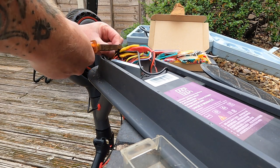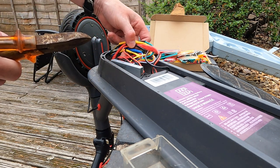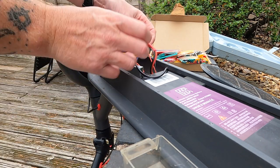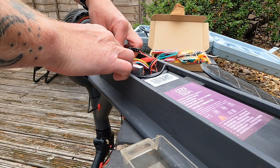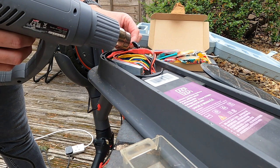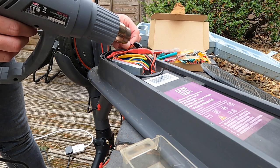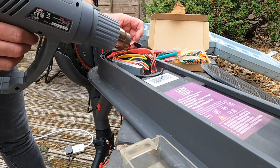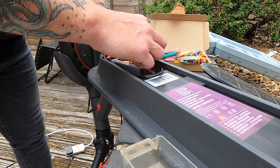Just removing a couple of the old cable ties that helped keep the loose cables neat and tidy. There are only two cables that go to the battery. You'll see that you can't really go wrong understanding which ones they are and connecting them back up. If you've taken the battery cover off, you'll see lots of this black plastic, which is the waterproofing used on most of the connectors. The best way to remove it is a heat gun on quite a low setting — that melts the waterproof plastic coating and it's very easy to remove once the plastic starts to melt. It is a bit sticky and really, really messy, but it's the easiest way to get rid of that coating.